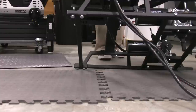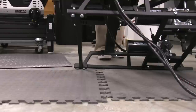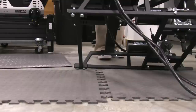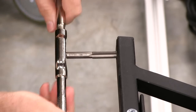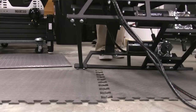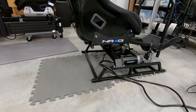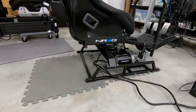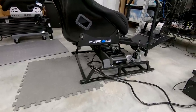And yeah, it's just two bolts on either side for this bar to be attached to the back of these two lateral rails here. And the only problem I had with this was I did have to chase the threads in these holes because the powder coating had gotten on the threads. And yeah, just had to take a tap, a 10 millimeter 1.25 tap, and just clean up the holes there, as you can see. And then, yeah, we're good to go. Easy to bolt it on. So make sure you don't forget that piece. And you'll see or have seen segments in here where that was not on there. And I just want to clarify that that bar does need to be on there.